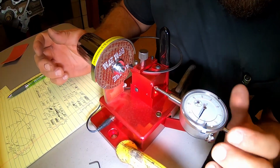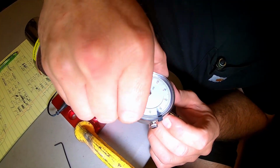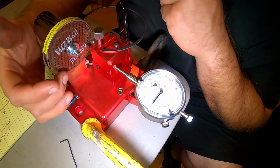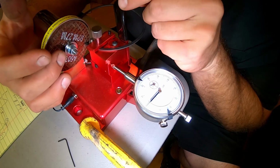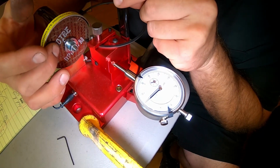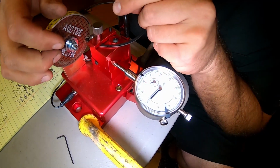So the last thing before you start grinding, you got your dial indicator right now, which obviously it's showing 30. We're gonna spin that to where it's showing 0. And what I do there is I just touch it and let it bounce back. And as you see right now, we're at 0. I'm gonna back off of it a little bit, turn the wheel just a touch, and see we're about 1/1000th difference. And right there, about 2/1000th difference. I'm just slowly turning the wheel down around 2/1000th difference, which obviously I need to move there because it's closer there than anything so far.